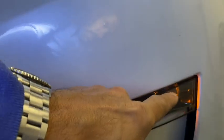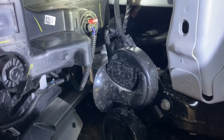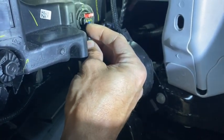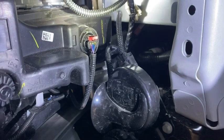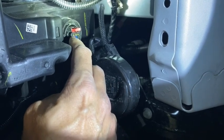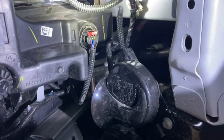If we go over to the passenger side it's not done yet - you can see the difference. Now there is a fog light as well in here. To get the fog light connected, you do need to do some wiring, because the Standard Range Plus doesn't have the built-in fog light programmed. Basically this purple wire is the amber light as well as the LED strip light; the blue wire is the fog light but it's not getting any power from the car because it's deprogrammed in the Standard Range Plus. So what we need to do is jump it - get the blue wire to connect with the purple wire so the fog light stays on with the running lights.